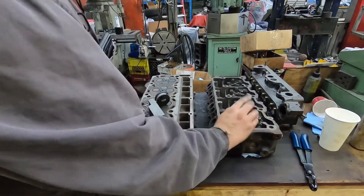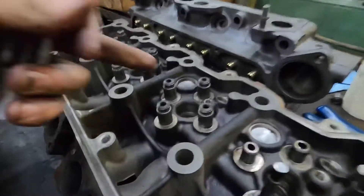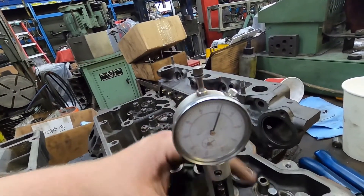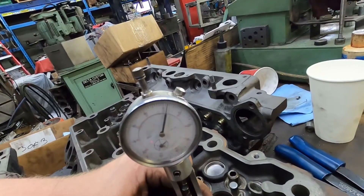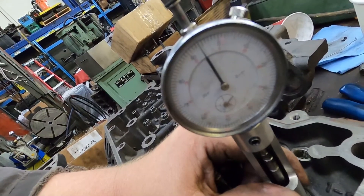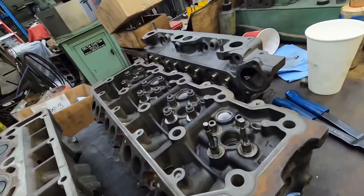Obviously they would usually be clean, but like I said, these are just junk heads. What you want to do is make sure your valve seals off so you're actually getting down to the bottom. I'm starting at 100 thou on this one, so it's come around twice — that's 220 thou for the install stem height on this one, or 222 thou. The one next to it is actually lower: 200 and 195 thou. That's how you check install stem height.